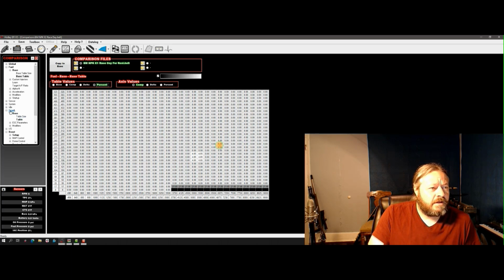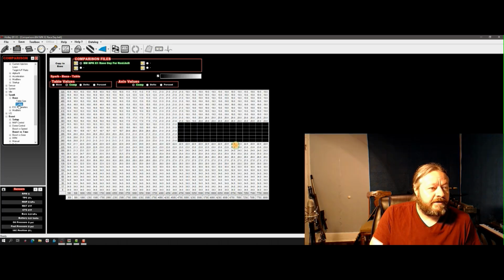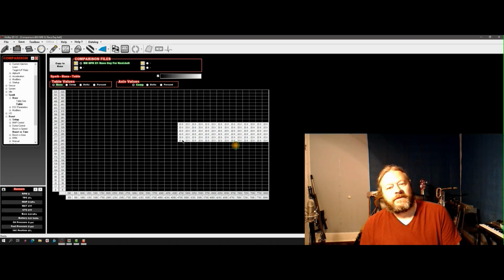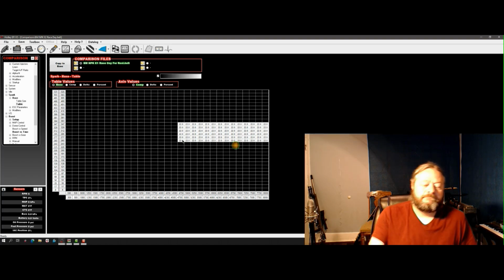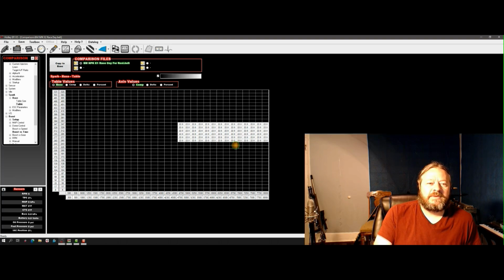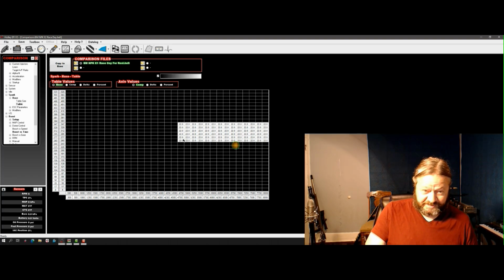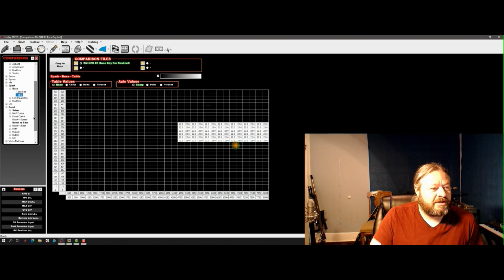Okay, so spark. Let's go there. I believe, if I remember right, what I did out back was add 1 degree. In this case, I know that we're low on timing, and I'm adding a degree because I know it'll make more power. And we can use it, so I'm going to do it. You have to remember, we're working with what we got here. BeerMoney's a stock block LS, so we can't go crazy with the tune-up here and there and everywhere, but this is a risk I'm willing to take out here. I think it'll be fine. And I know it's going to make more power. So I put a degree in it there to help run the back a little bit.